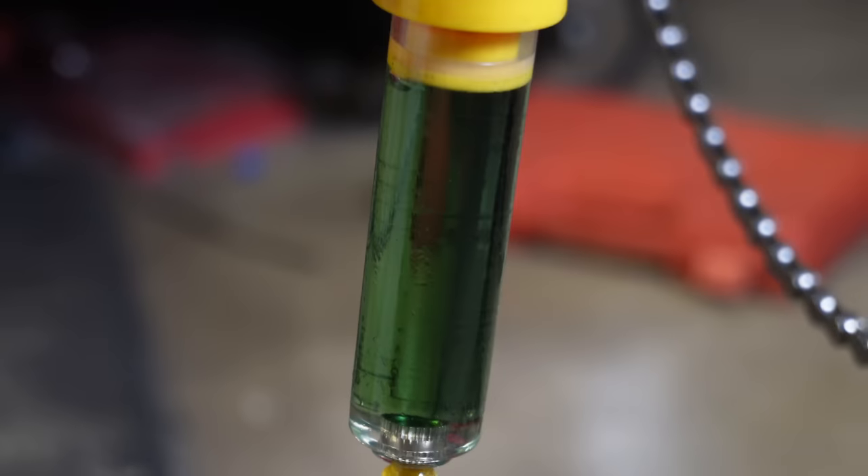I've only been on one ride so I can't definitively say that bleeding procedure works, but the SRAM DB8 brakes with metallic brake pads was all I've ever asked for in a brake — cheap, reliable, and powerful. If you use my Shimano bleeding method, the procedure is exactly the same but you've got to send the fluid faster through the brake lines because the orifices in the bleed ports are smaller. Hope you enjoyed the video — watch the next one here.